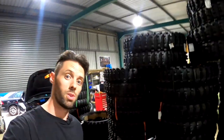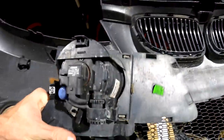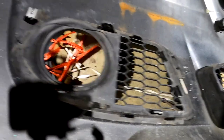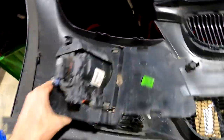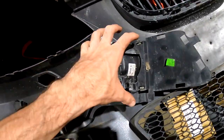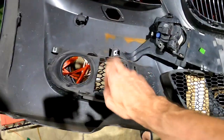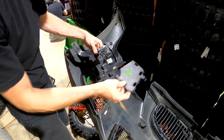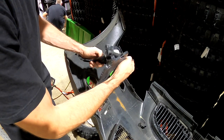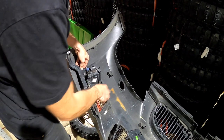Because the trans cooler is on the passenger side of the car, there's a space for it but there's no real airflow to it. As you can see on the back of the front bumper bar, next to the passenger side fog light, it just has this big extra plastic block-out panel that sits behind that grille. So as we have the oil cooler sitting there now, we've just removed that — just a few bolts to pull the whole assembly out. We're going to trim along there to remove that excess, and then it will still bolt in as normal. It will then resemble the driver's side, which already has an oil cooler in there, giving direct airflow straight to the new trans cooler. That literally took two seconds to just cut across there — doesn't look too messy, just hit it with a file to clean it up and that will mount back in and you've got airflow.